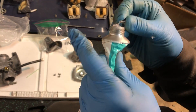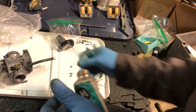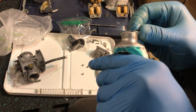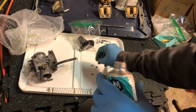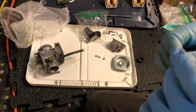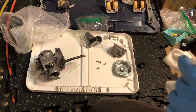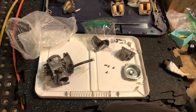That's because we would like to avoid corrosion between the dissimilar metals. The body of the carburetor is aluminum, and these screws, even though they're coated with zinc or nickel, are steel. Eventually the zinc coating is going to be sacrificed and the body of the carb is going to become the anode. So if you grease these threads really well and prevent any electrolytic substance from entering the junction, it's going to really help. And also, it's going to make the screws easier to remove next time you have to rebuild the carb.